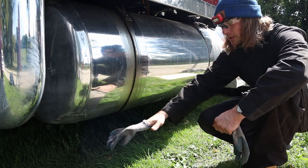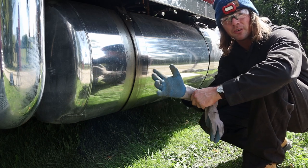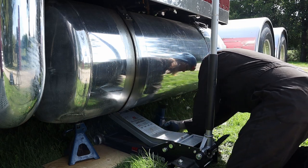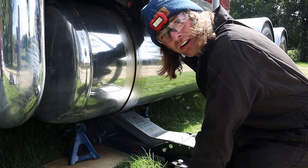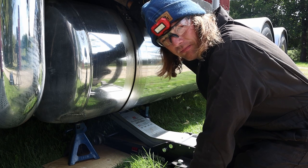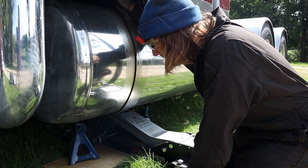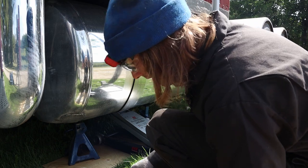The first step of this job is to support the tank from underneath, then undo the strap and see where the leak is coming from. This is actually dead simple — it's literally just a bolt you back off and the whole strap comes off. It won't be seized because the truck was just in the shop for the fuel pickup tubes and they took the strap off for that, and that's kind of where it started leaking from.